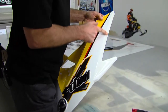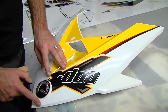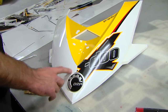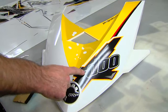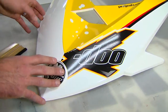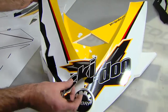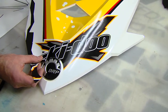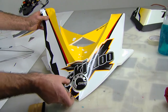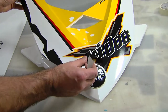Make sure that lead edge is really well stuck down. You don't have to heat gun this stuff, but if you feel comfortable doing it, it wouldn't hurt — even just to go around the edges and heat gun everything. Piece number four goes right in here — last piece. The key with piece number four on this specific kit: the Skidoo hyphen comes over and will overlap that, spanning this little area. That's the only way we could get it to look good on the panel. This is probably the most difficult piece to install for this specific kit.